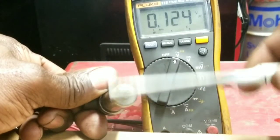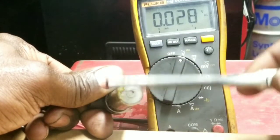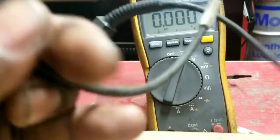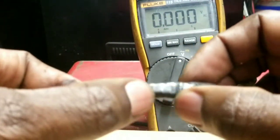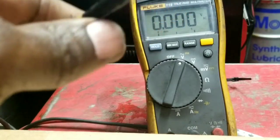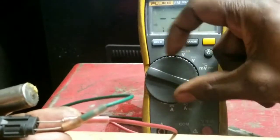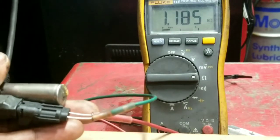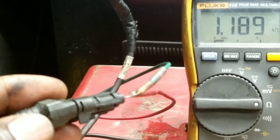That's just a simulation - imagine this is the exciter ring passing over the sensor over and over. Once you get that signal, you know the ABS sensor is okay. Now you check for a broken wire. This one was broken here - I just joined it back, soldered it, and taped it up. Sometimes what happens is it rubs on the wheel or the chassis. You check your resistance - you see the resistance on this one is 1.1 kilo-ohms. I think that's within spec. The ohm reading should be between 700 and 3000 ohms, so this is within specs.